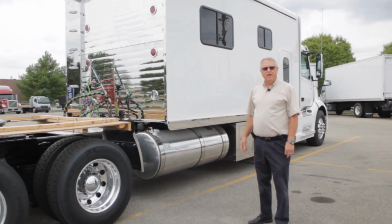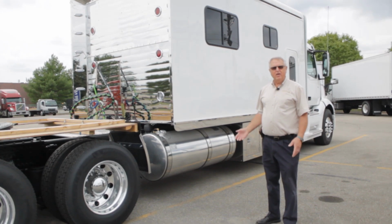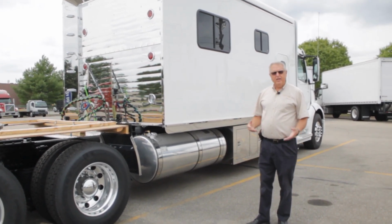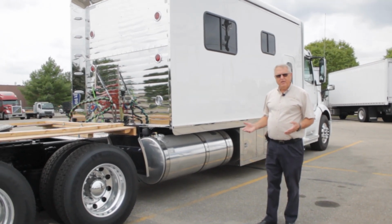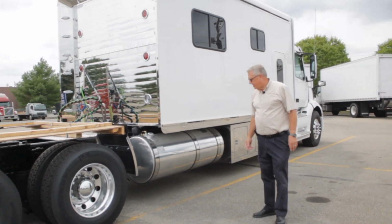2 I have 365 front steer tires put on them. The other 2 have 315, so either one will work. And if you select to put the wider tires on, we don't do it because of weight capacity, we do it because of longevity of the tires.